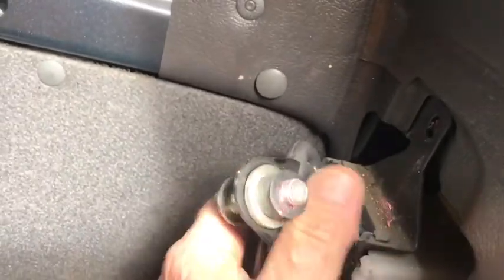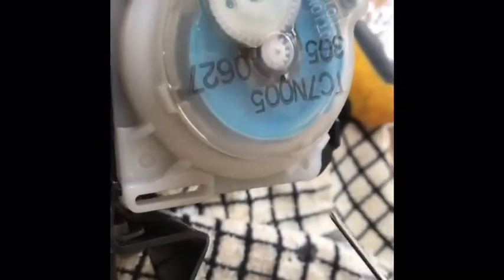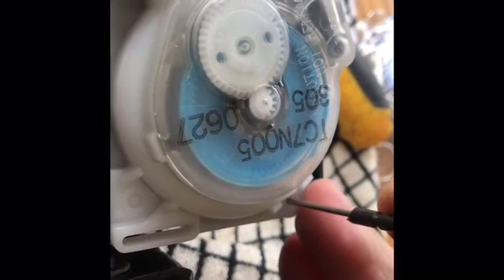Now I'm going to remove the plastic cover. The white plastic cover on the mechanism needs to be pulled off — just do it very gently. There are three little white dowels that need pushing out with a screwdriver. Do this on the side with the cogs on.